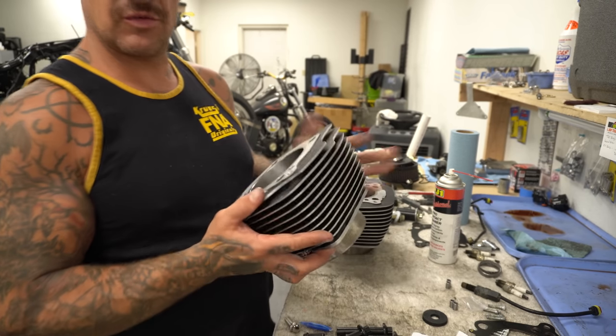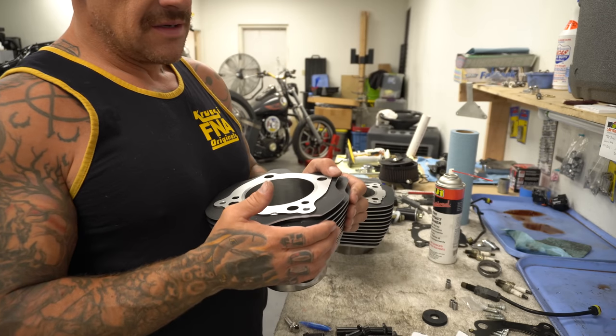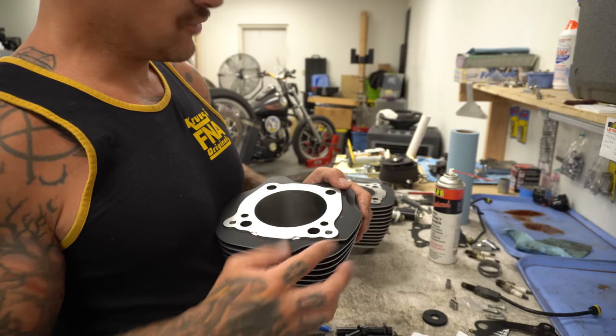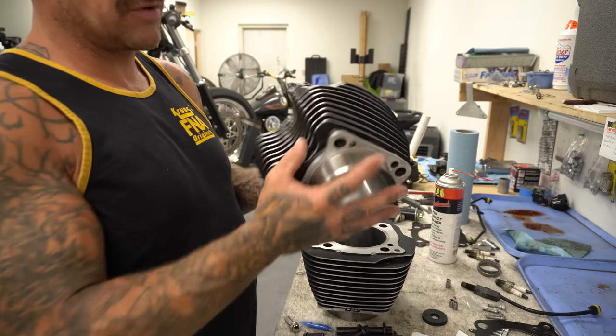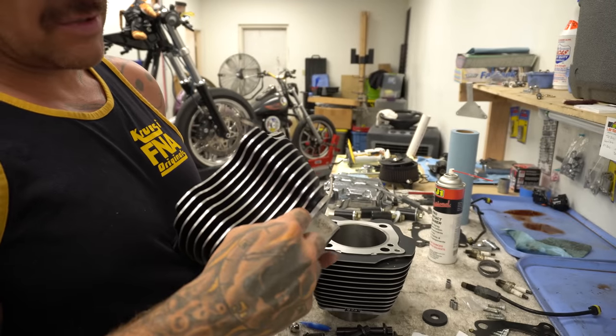I had to do a bit of machine work on these because we're sponsored by S&S Cycles, so we got this kit for free. But it's also a hand-me-down kit because one of the fins was broken, so someone sent it back. One of the fins was broke, and we also have two fronts. So these are both front cylinders, so I had to machine this section right here to clear the tappet block and then the push rod.